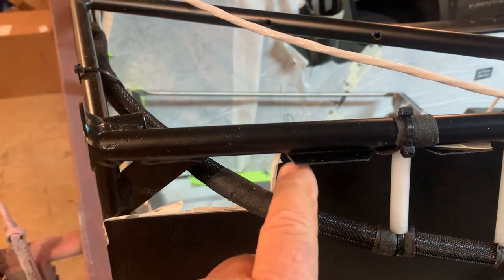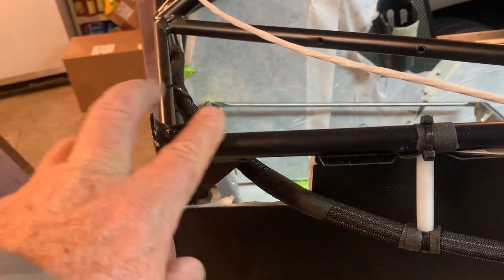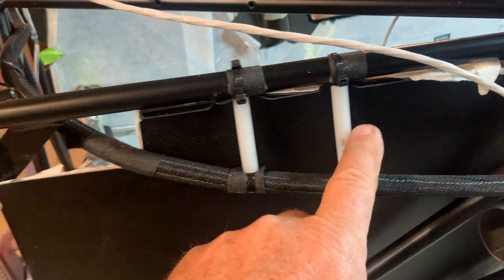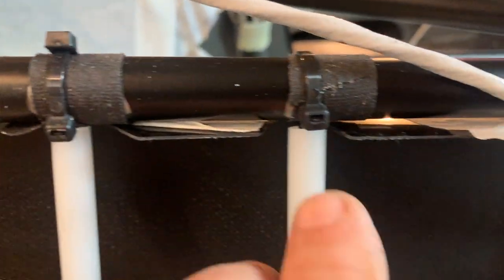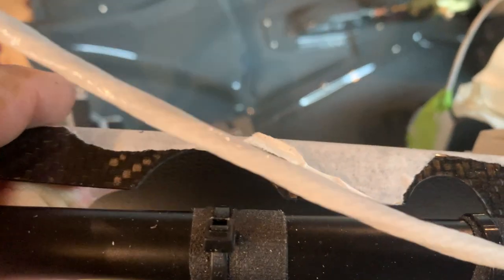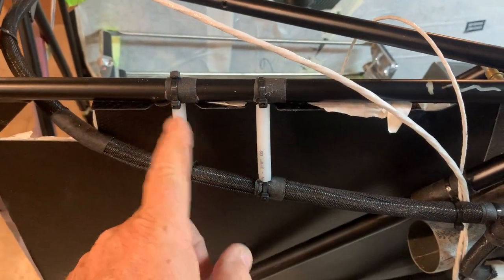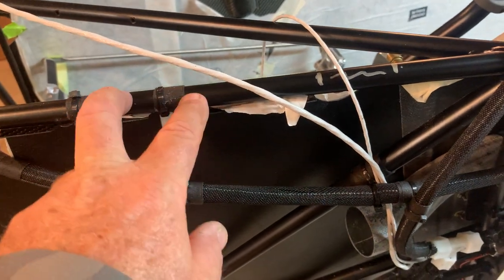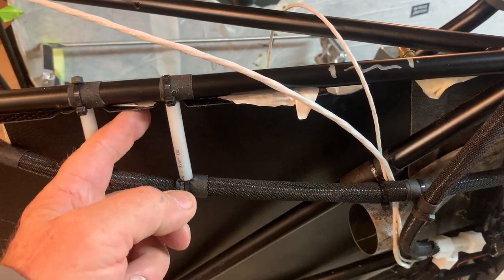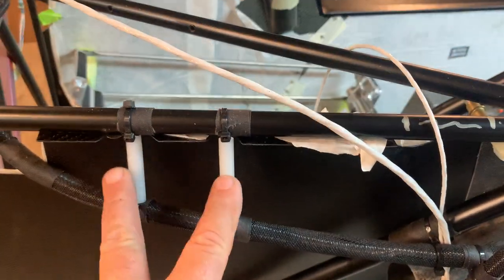Here's where we talked about they had a cutout for this fuel line to come through. When we were talking about fuel lines in the video, you remember I told you to fit this panel before you did these standoffs, because this piece has pre-cut areas out there for these standoffs. See right there, there and there. So when you put that panel in, it's going to go underneath there, and it needs to have your standoffs here. It doesn't give you any measurements on where to put these standoffs. And so every kit I did, I would put them on there somewhere and then get ready to install this right when I'm getting ready to go flying. And of course it was hitting these standoffs and I had to go and move the standoffs from the inside, which is a pain. So just do it right the first time.